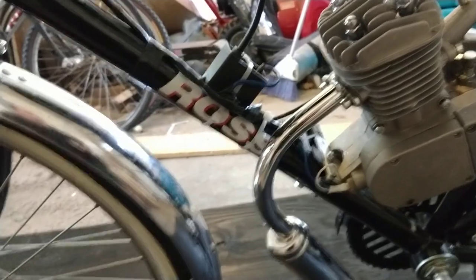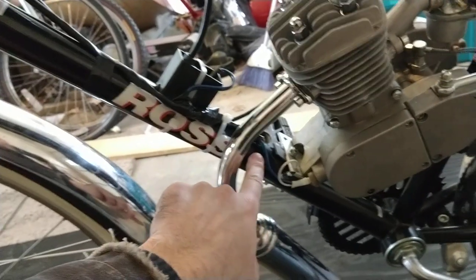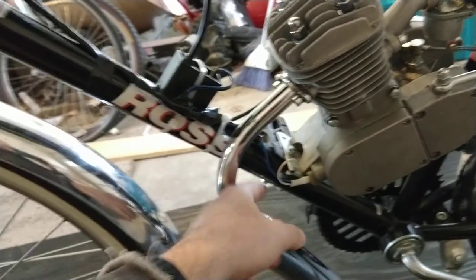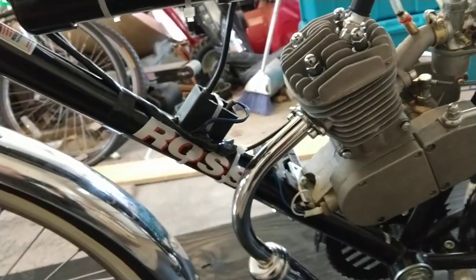The reason for the different mounting options is that different bike frames have different dimensions — some are oblong, some fat, some narrow. On this bike, the superstructure transitions from a smaller rounder tube to a more oblong larger tube, which works well for the back stock application but not great for the front. Drilling directly through the frame was my solution and it works great. I also added a little silicone in there to prevent rusting long-term.